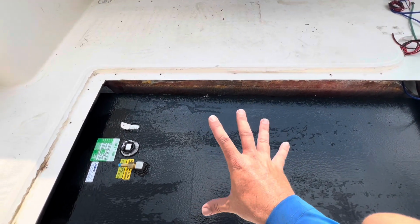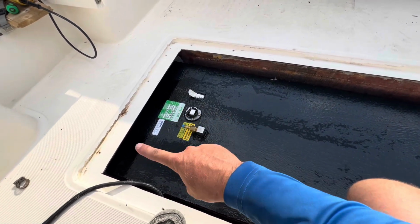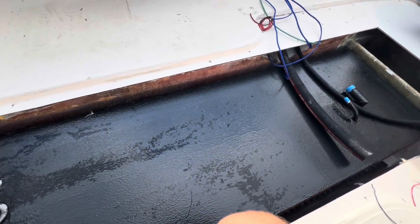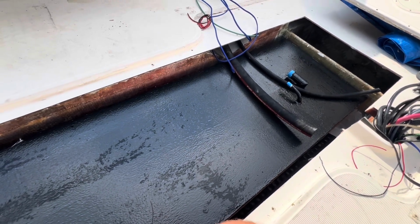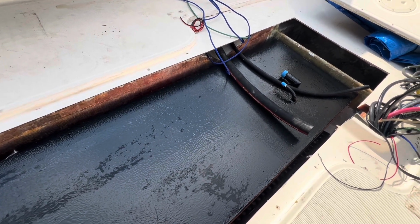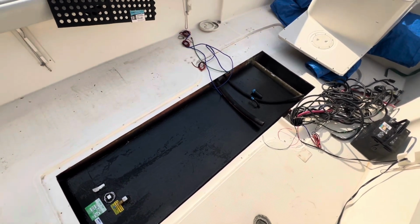So I think doing it that way is going to be just fine, as well as the redesign of the bulkheads to allow much more water flow up underneath there will solve the issue, and this tank will last much longer. I mean, hell, the first tank being fully foamed in and uncoated lasted 20 years. So I don't think I'll have this boat for 20 years. It'll last me for my lifetime with the boat.